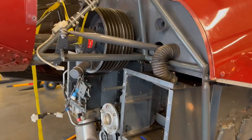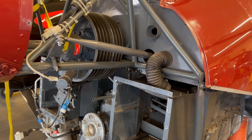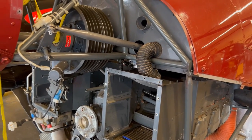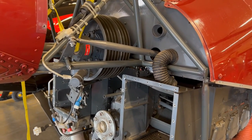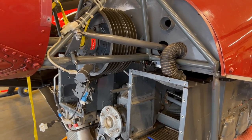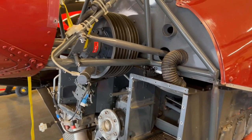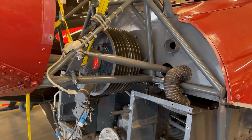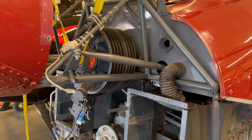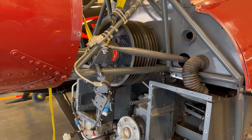That's the most oil I think I've ever seen on belts. They were so saturated with oil that you couldn't pull more than about 17 or 18 inches of manifold pressure. He said he was able to fly the last part of the flight here at about 75 knots, and then as he came in and landed, slowing down to a hover taxi, the horn was on as he set the aircraft down because of the belts slipping again. That's the worst case of belt slip I think I've ever seen.